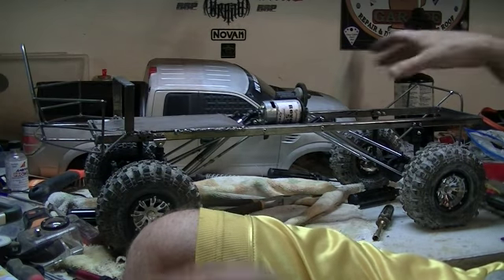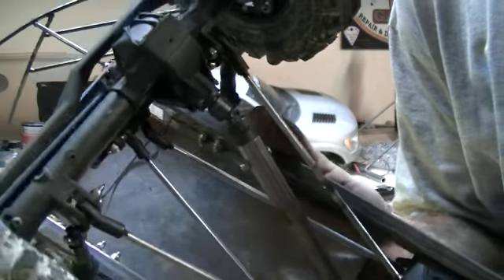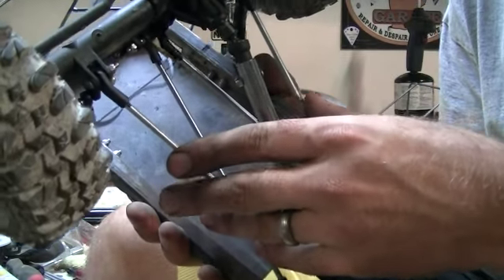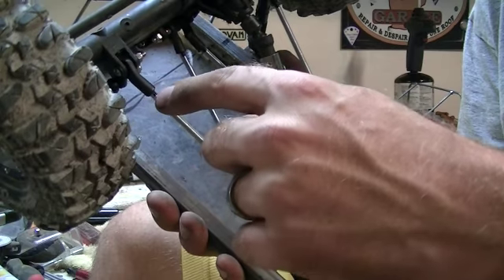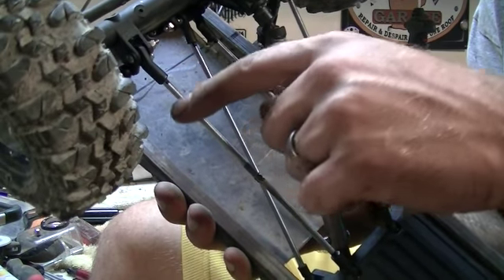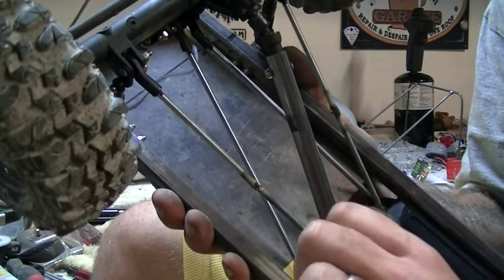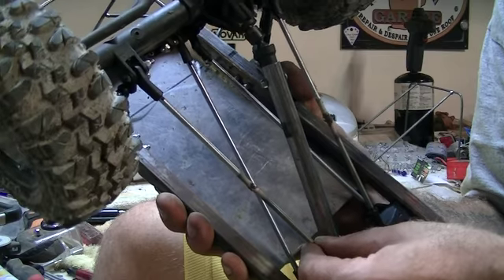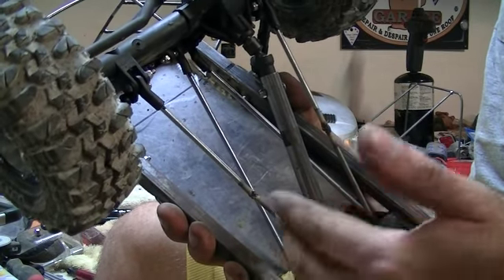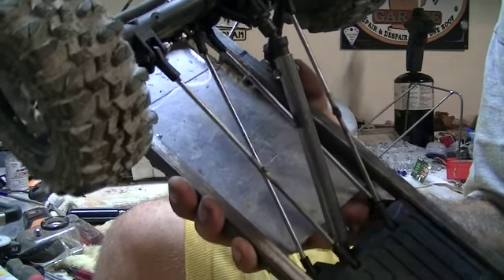Another crucial thing for those who want to make their own links: when you go to strip down your links, take a sharpie and mark the ends where the rod end stops. Put a mark on your link so you know how far to twist it back on, then measure from one endpoint to the other — that gives you the length to cut your brake line. The brake line will sleeve right on and won't spin around because it'll be locked in place by both rod ends.